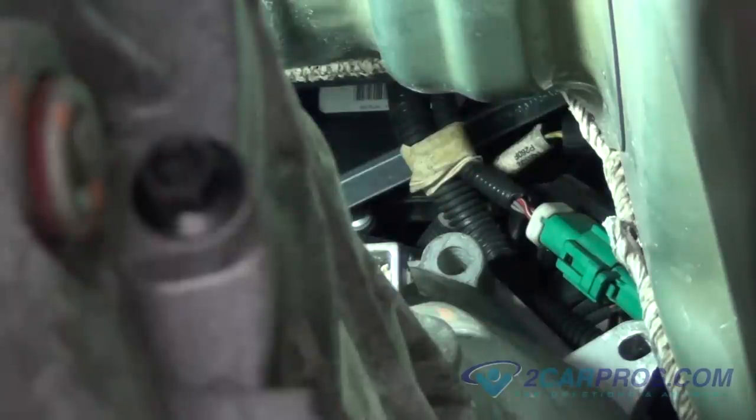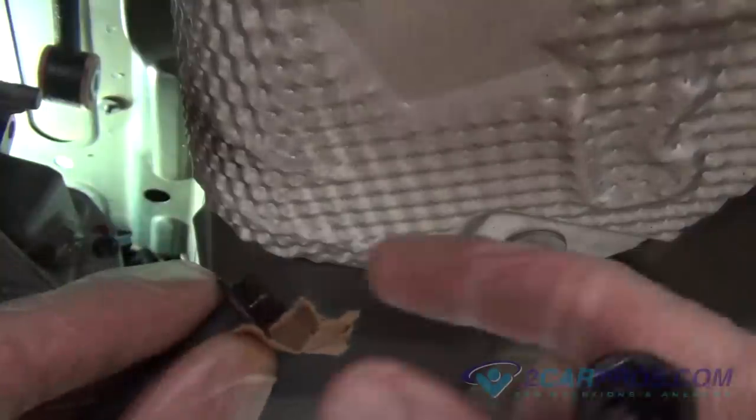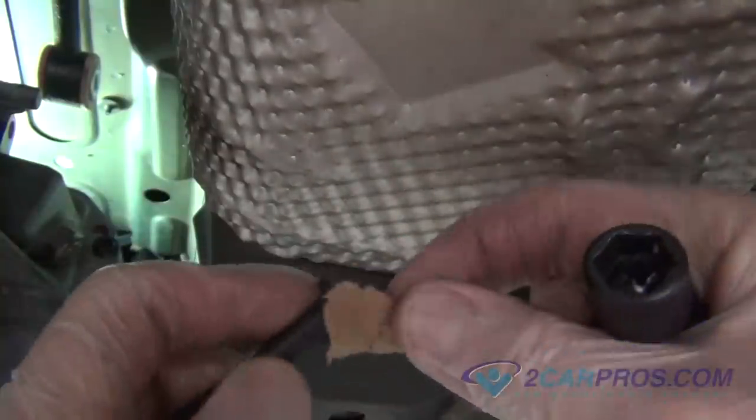The hardest bolts to install are the two top ones on the transmission's bell housing. An old automotive trick is to use a small piece of paper to hold the hardware bolts in the socket when installing them.